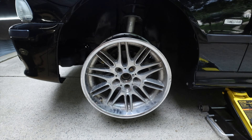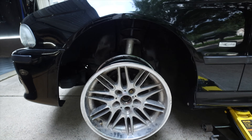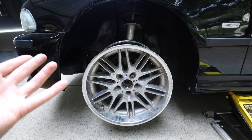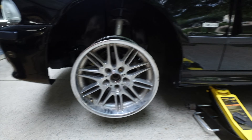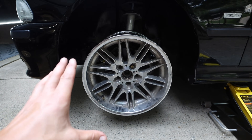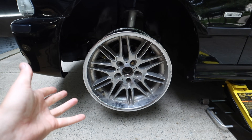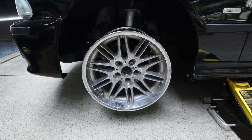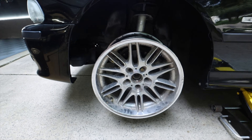The only way to do this on these cars is to run a very small spacer — most people run 3mm but I'll probably go with 5mm, which can change depending on your suspension setup. I'm on stock suspension. I'm running an 18x9.5 on all four corners with a 265/35/18 tire — a really nice meaty squared-off setup. That will change the way the car feels, handles, and steers. Also, since it's a square setup, I can rotate tires and don't need different sizes, which makes everything easier.